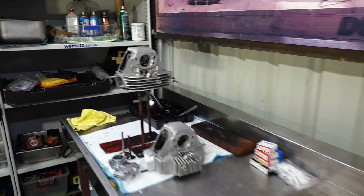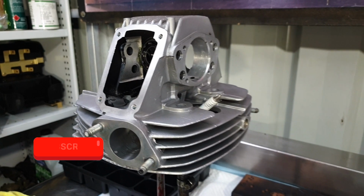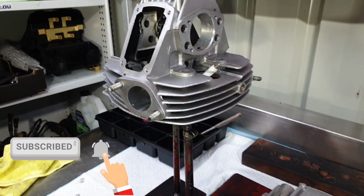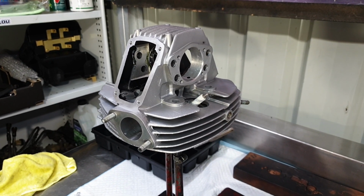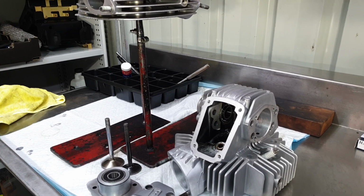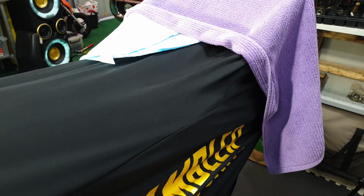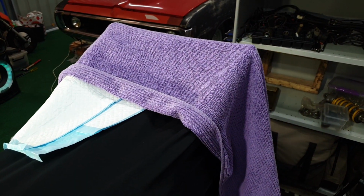This week I want to start by doing some work to the heads, look at fitting a few of the rocker arms, start to shim the heads up. Also, I want to get into the fork legs, separate the chrome lowers where the seals run from the aluminium parts, send that all out to be repaired and refurbished. Might even have a bit of a look at the dashboard as well. So rip the cover off the bike, see if we can maybe fit those gauges. Okay, that's what we're going to do.